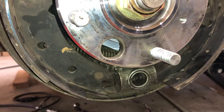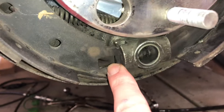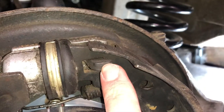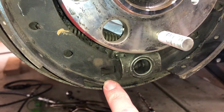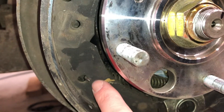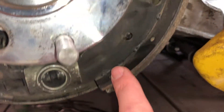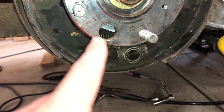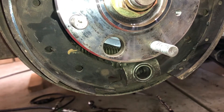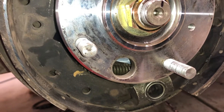Here's something wrong I already noticed: this notch should not be here — that's to fit over the parking brake cable right here. Whoever put this on a long time ago had it wrong. The spring is connected on the first hole, going at an angle, which doesn't make any sense. These brakes are all messed up — I'm glad I tore into this. I never noticed it when I did the axle, but we'll keep going and get it fixed.